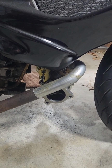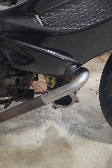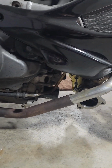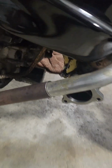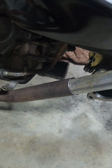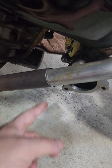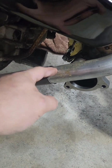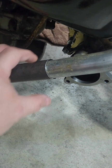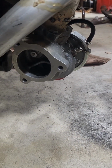All right, that's what she's gonna look like. That's gonna be the turbo inlet pipe. I just gotta trim and weld up this one pipe here. I kind of made it a slip fit so I can figure out all the bends, and now I'll cut it and spread this smaller pipe out a little bit and then weld it up, and then I'll order the downpipe